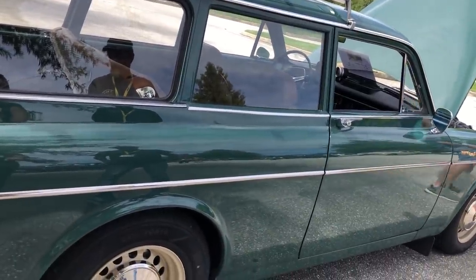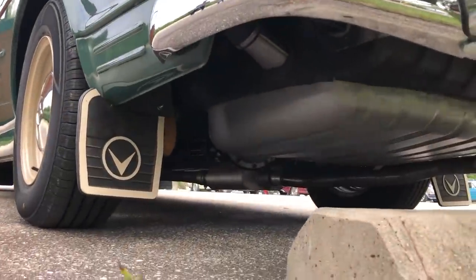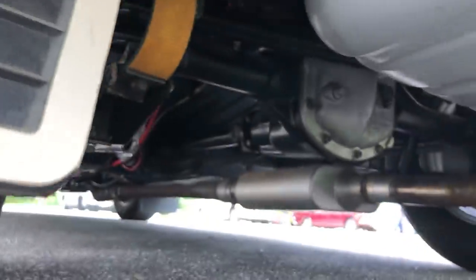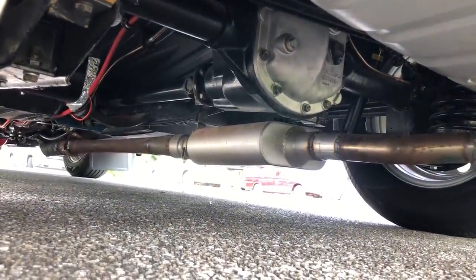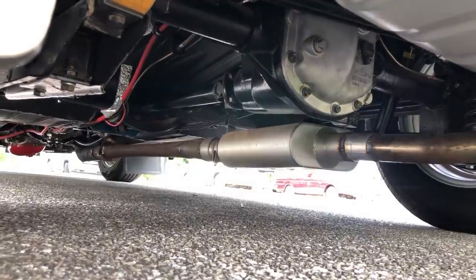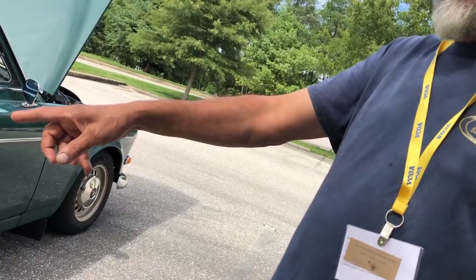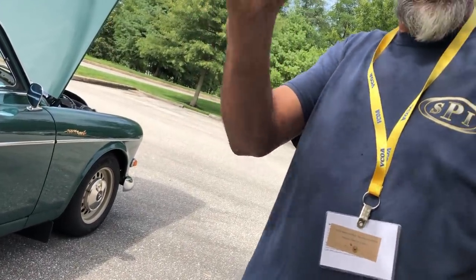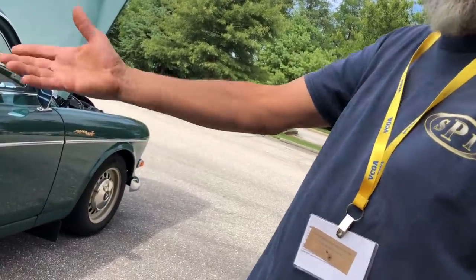You've had to update the rear axle to do the 5x108. What I did is I took a 740 axle and narrowed it - sent the axles out, had them cut down, re-splined. So it's a 740 axle. I took the original axle, welded it to a table, cut it all up so I could lay everything in as a jig. Then they were all the same size and I had those small tires on the back and it revved too high, so I widened the wheels - cut them and put a one-inch band to make them wider. I put the big 215s on and dished them, which looks better and really helped the gearing.